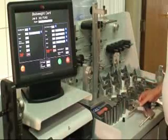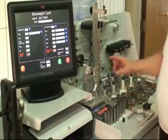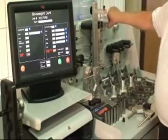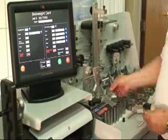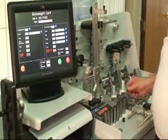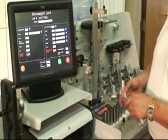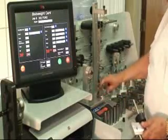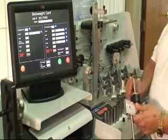That's one half of the equation. By taking the other set, I'm going to come back with the same build and go ahead and grab seven shims. Right now I am a half off, but I'm going to come in and add one half gram. These particular weights all weigh the same. The time spent spinning versus using quick nuts is insurance for safety — it's your option, but when one of your technicians is over at the eye clinic, or worse, you're not going to think it was worth it.